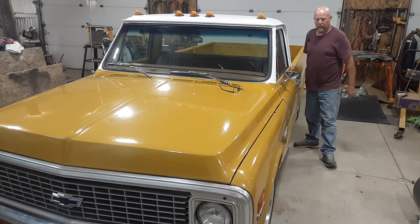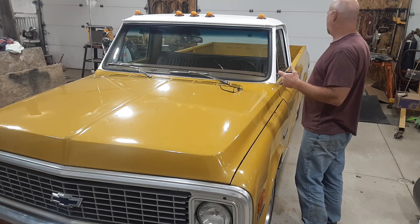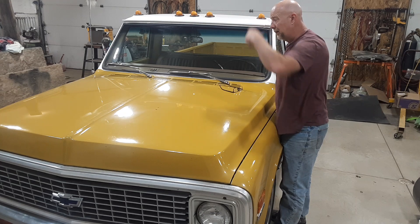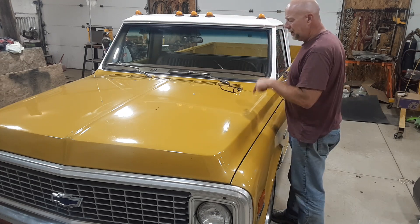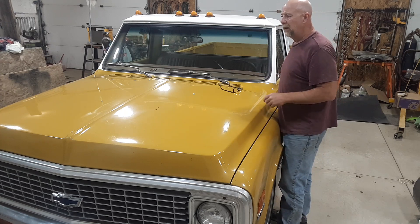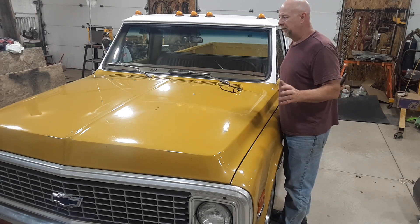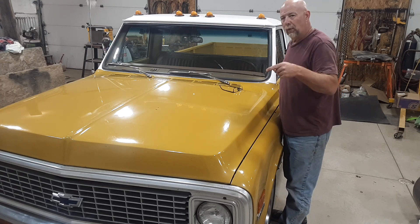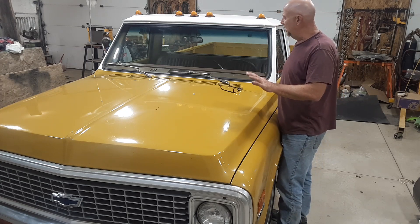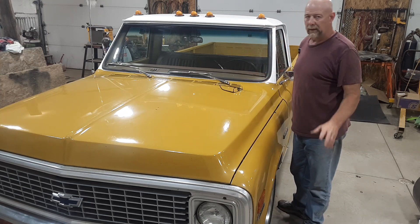The main reason I bring up lights is, darn Chevy door shuts so bad - my license plate light quit. I was underneath the truck so I didn't bother showing you guys that. It was the wiring harness plug to the truck that was just loose. Rather than mashing on it with a pair of pliers and jamming it in there hoping for the best, I went ahead and spliced it. If it needs to be done again, there's an extra loop of wire so somebody can cut the splice out and re-splice it. It's a waterproof splice, so it should be good. All the lights work - dash, headlights, turn signals, brake lights, all that stuff's working.